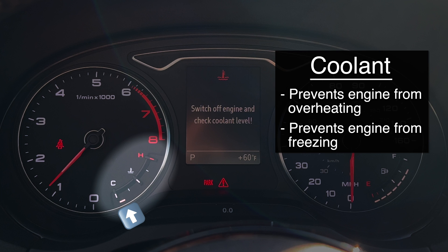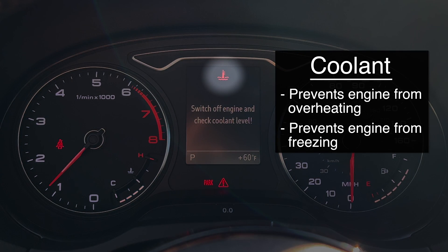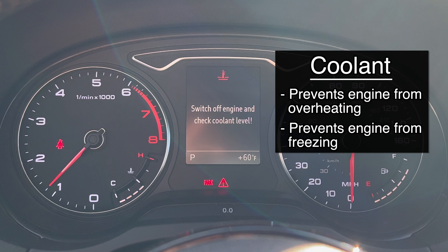After a few minutes, the engine temperature will creep back up to the normal level, which is where it should be while you are driving. As long as your engine stays at the normal operating temperature, you'll need to keep an eye on it. Ideally, you'll want to check the coolant level as soon as you can for some additional peace of mind. If the car doesn't get to normal operating temperature, or if it goes past that line, that's a bad sign and you should pull over, open the hood, and check the coolant level. Let me show you how to do that now.